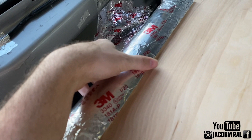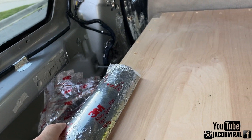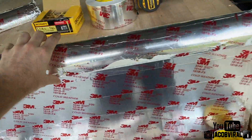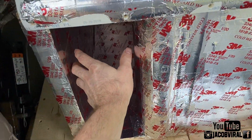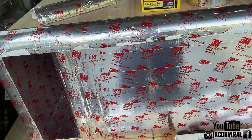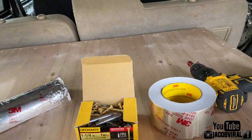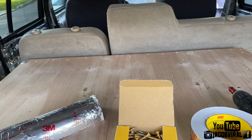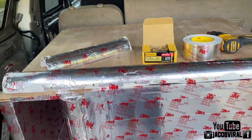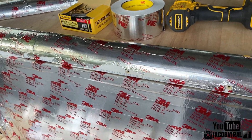I'm looking into doing some roundovers maybe over here as well — I could use a router and do a smooth radius — but it's not as critical as by the port and on the back end of your wall build. Anywhere where you get most of your output from — which is your port area — that's the most important area to look into improvements. A roundover there won't matter as much in other spots. It's just like whenever you block sound waves — if somebody is sitting in your back seat, they're blocking some of those sound waves, which affects how the vehicle resonates and how much output you get.